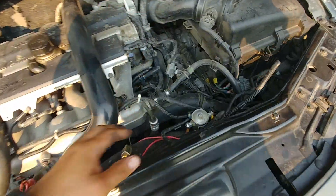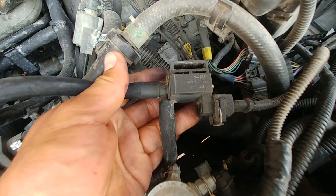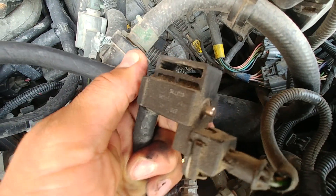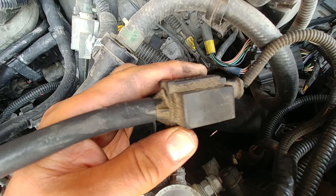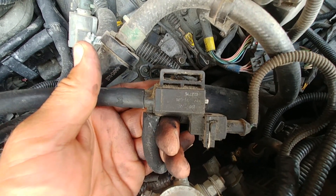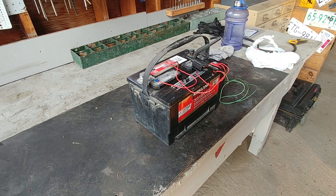We do have a vacuum leak — it was detected, a small vacuum leak. It all relates to this purge solenoid. I diagnosed it and found that the purge solenoid doesn't seal properly, and here's the small leak detected. We have a new one we need to replace it with, to get rid of that engine light.